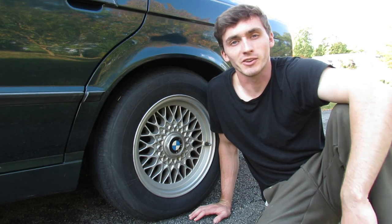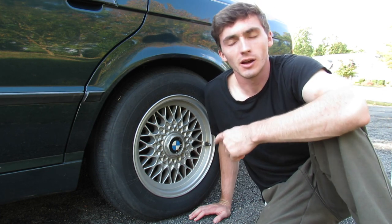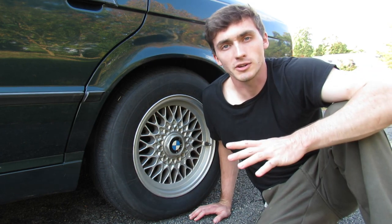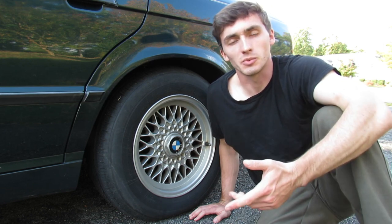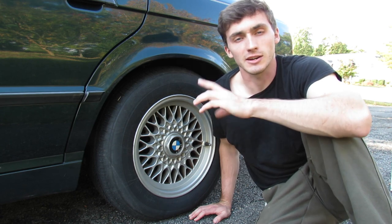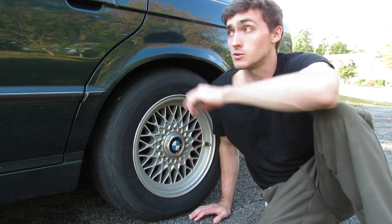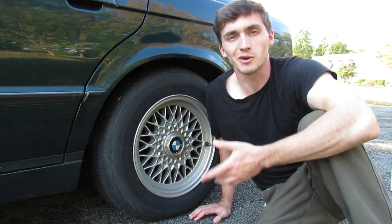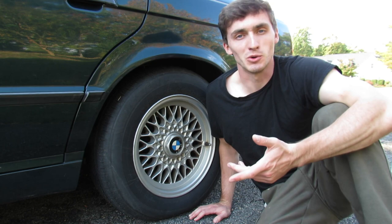The front is all done and back on the ground. Before showing that, we're going to take care of the rear — we're around back now. I also decided to put the car back on stock wheels for the before and after, so you can see what it looks like with stock diameter wheels and tires. Before we get dirty out here, we're actually going inside the car for the first couple of steps — we need to pull the rear seat and rear deck lid out to access the top bolts on the rear shocks. Other than that this should be pretty straightforward.